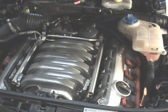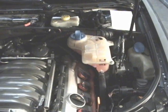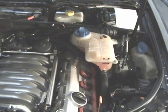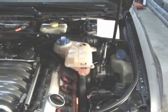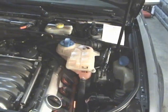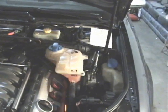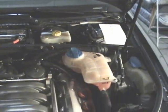One last thing: always remember when you're done you're going to lose a little bit of coolant. You can go ahead and top off your reservoir with a little bit of water. It probably only loses about eight ounces, maybe not even that much — maybe four ounces. You can see this one hasn't been topped off and it's still reading in the same zone. If you don't have Audi coolant, a couple ounces of water aren't going to kill you — use purified water to keep corrosion down.